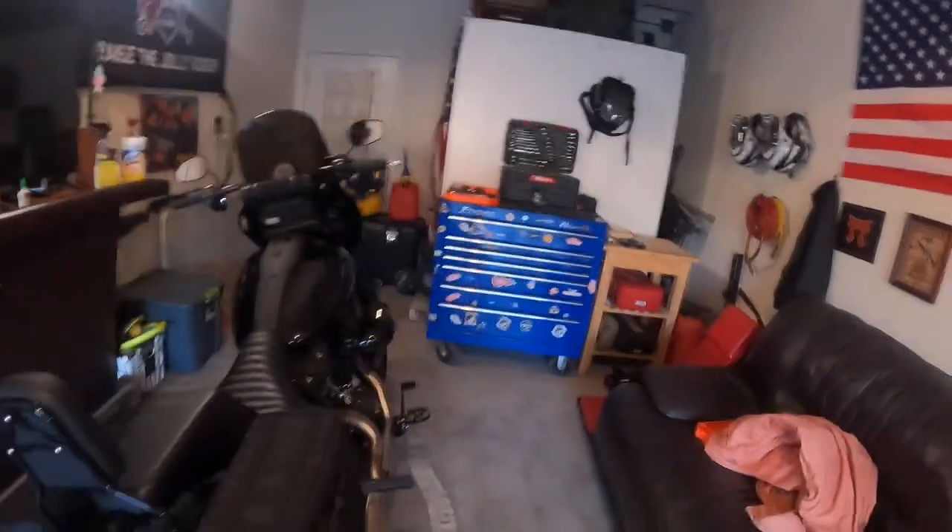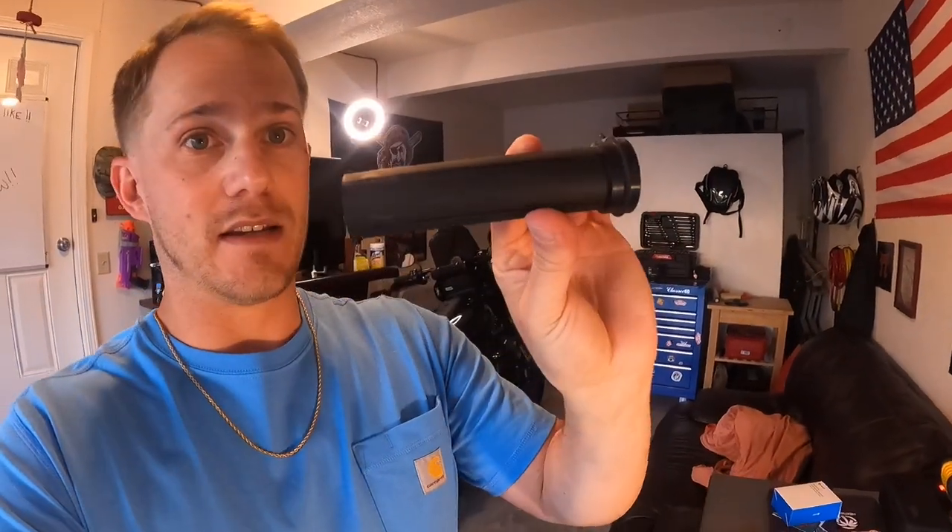Next time I might go with brown — probably get the same ones and just switch them. Now, I did mention I got the Drag Specialties throttle sleeve for $9.95. Now that I'm done, I definitely didn't need to get it. I popped the old one off — I had the grip on it, used the razor knife, just put a slice down the grip, and it popped right off. There's no glue on it, it's not nasty — it's literally perfect, exactly the same as the Drag Specialties one. The difference is it has these grooves on it. On the Harley Davidson, the throttle-by-wire is actually part of the tube, so if you want to save $9.95, you definitely don't need to get the sleeve.